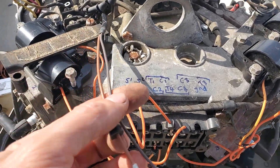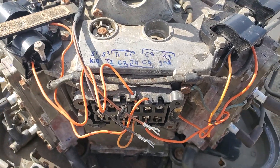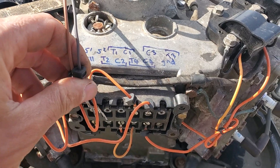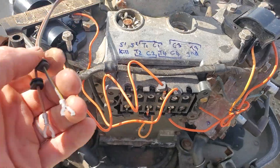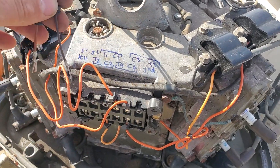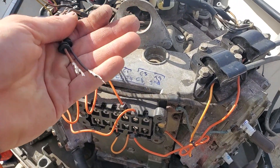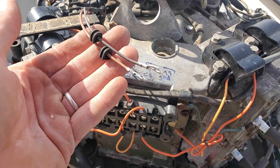Now it's understandable that I could go from 300 down to 280 volts — that's understandable, a small drop is fine. But if you're getting like 250 to 350 volts and you put it on the pack and you're dropping down to like 80 or 50, then this pack is chomping like 70 to 90% of the juice and there's something wrong with it. A small drop — this thing's hardly even dropping anything, I don't even think there's a noticeable difference between connected and not. So that's stator capacitor charging wires — that's how you can figure out what's going on.